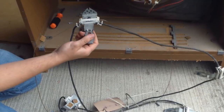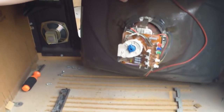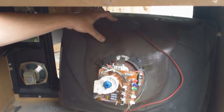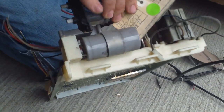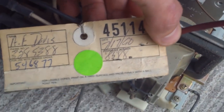Once the tray slides out, you have wires holding things in place. At each corner there's a bracket with usually three screws — one in the middle and two on top. Remove the bottom screws first so the weight stays at the top; that way the TV doesn't break the hinges and crack the plastic. Also, there's a capacitor in here — don't mess with it, it's full of bottled-up energy and can explode.